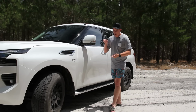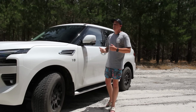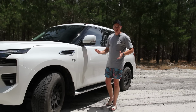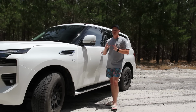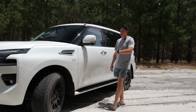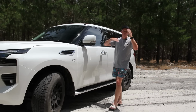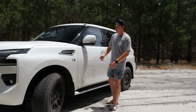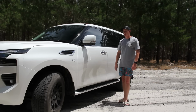And actually yesterday, my Airbag Man kit came, so another Australian company. Airbag Man, who I've dealt with for a long, long time, and I had their gear on my Trident, never missed a beat. It was bloody good gear, and the quality and the service from those guys, Jacob and Benny, do such a good job of looking after you, and that's why I went back. So now with the new airbags that are going to go on the rear of this, we've got the Kevlar bags that are going into the coil, or the coil assist bags. And it's going to have an onboard air system as well. I've got the tank. And also I'll be able to adjust the rear airbags on the fly with a wireless remote. So that'll be something new and different.